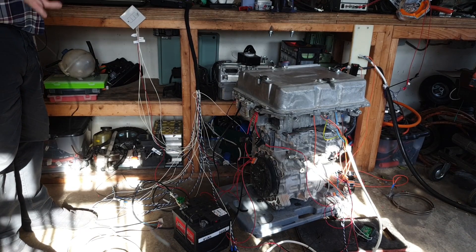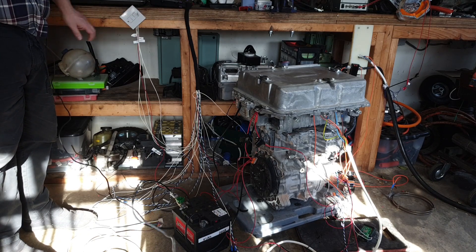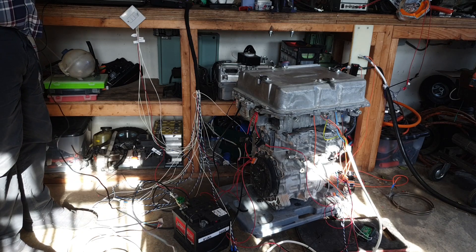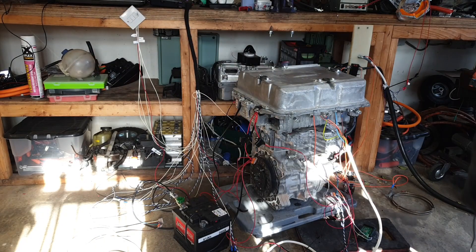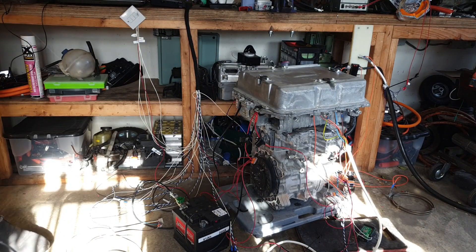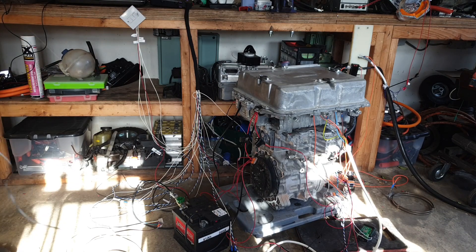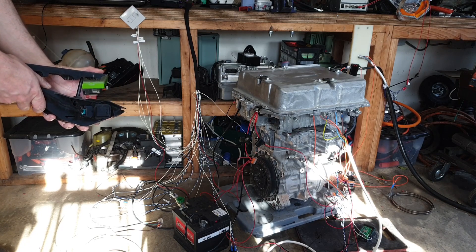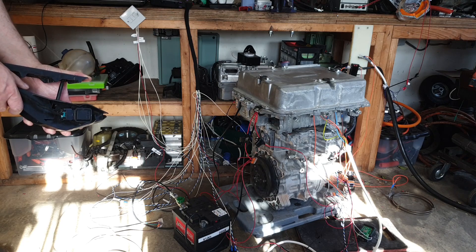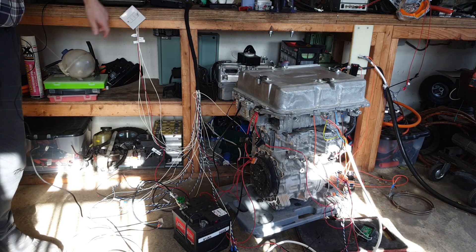Let's go for a little drive. Ignition on, flick the start — and because I'm a complete idiot and forgot to turn on the HV, that'll just do a pre-charge timeout. Good demo if nothing else! Let's turn on the HV. The demo contactors in the car are now on, we have HV up as far as our ISA shunt. Ignition on again — you can hear all the clicking — and a little gentle squeeze on the throttle pedal... and there we go, driving our Gen 3 system. Then we turn the ignition off.